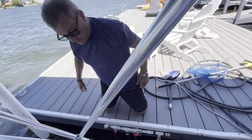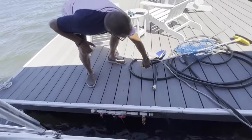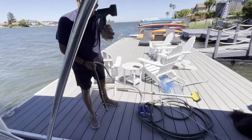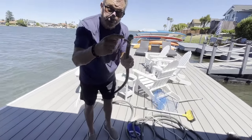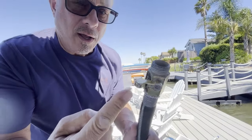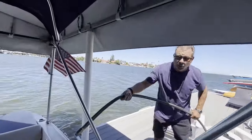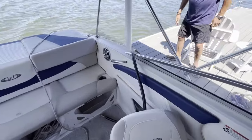We are going up. Now take this hose, and if it has a fitting on the end just take it off. Make sure this brass valve is off — which, like the other valves, means it's perpendicular to the hose. Then take it and throw it aboard the boat because you're going to use it to flush the engine.